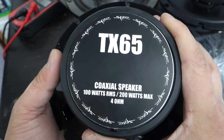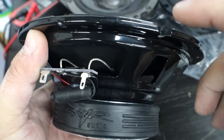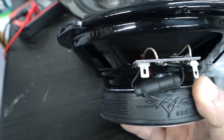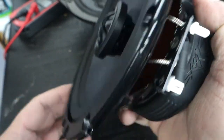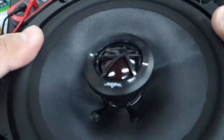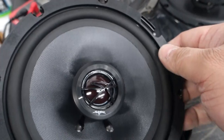The SCAR is coaxial, 100 watts RMS, 4 ohm. You'll notice the magnet is a lot bigger and overall mounting depth is thicker. There's really no problem in the rear deck of the TL for mounting depth since it sits within a chamber, but in your door this will matter. If you were replacing the MDX speaker, this might go past the edge of the adapter and be too thick — it won't fit in the door properly. Take that into account when selecting your speakers.